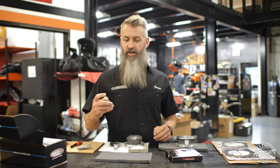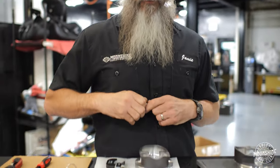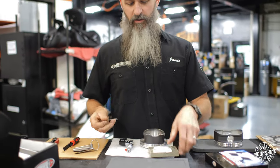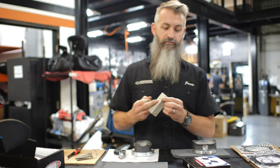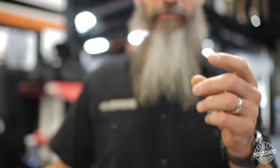A cool item we have right here is a plug made to a certain thickness which matches our ring lands. What we want to do is go around our pistons with this plug. This is taking the place of what you would normally have, which would be a feeler gauge.